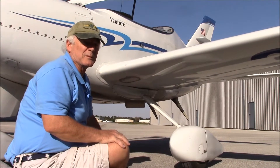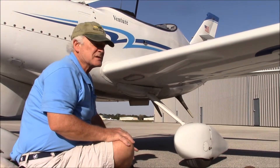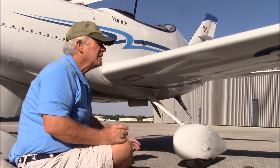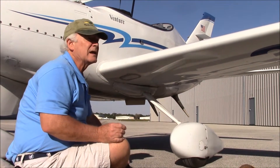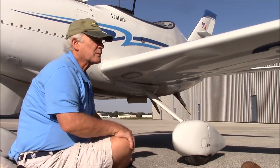There were a lot of people that had problems with the electric gear, so I converted mine over to an electro-hydraulic system. I had specific pneumatic and hydraulic cylinders made for me, along with a converted electric hydraulic pump in the back. I had the entire gear in and working, with a pneumatic system to back it up as an emergency in case something were to go wrong.